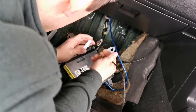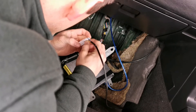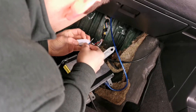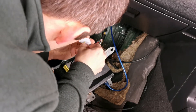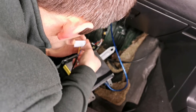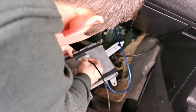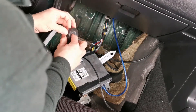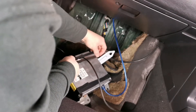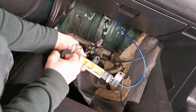Go down the hole you've cut — on your ECU each output has a designation, and two of them will say coil 3 and coil 4. Plug your two cables into the back; the pins have little locking tabs, make sure there's no debris, push them into the white connector until they click, and make sure they line up with coil 3 and coil 4. Slide it in until it clicks — no pushback on the pins, don't force it. Put a bit of electrical tape over the excess hole to stop dirt getting in.